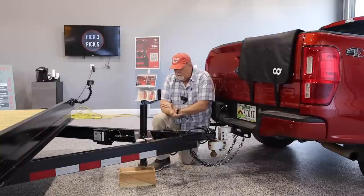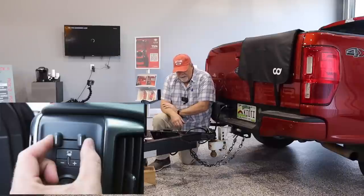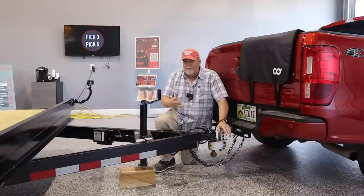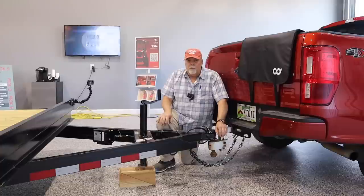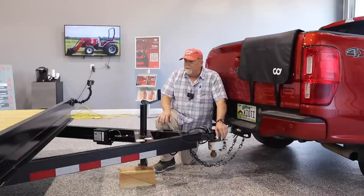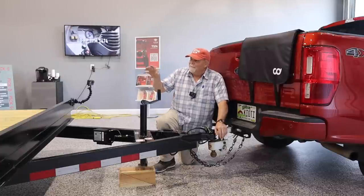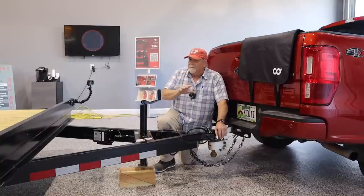Most modern trucks, it seems to me, have brake controllers on the dash. It's either a sliding spring-activated knob or a twist knob, or any variety of different adjustments, that you can use to fine tune how much braking pressure the trailer applies when you put on the brakes. That varies with every load, because right now this trailer weighs only 1,800 pounds and I certainly don't need much. If there's too much braking, the brakes will lock up and smoke the tires and you'll look silly. So I need very light assist on that.